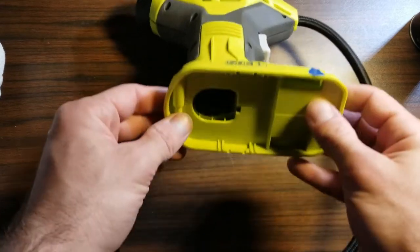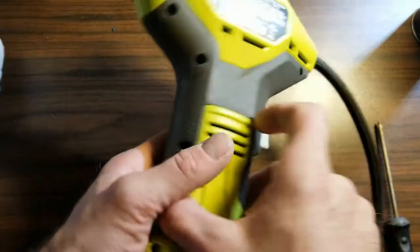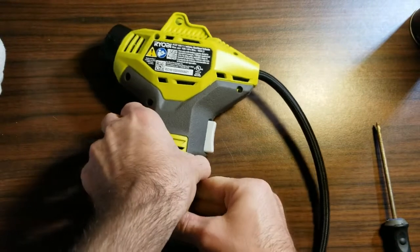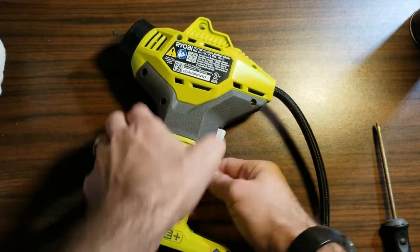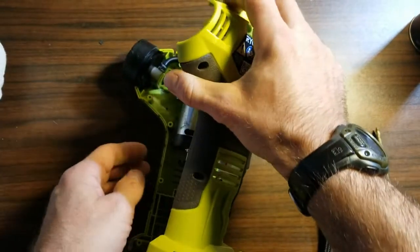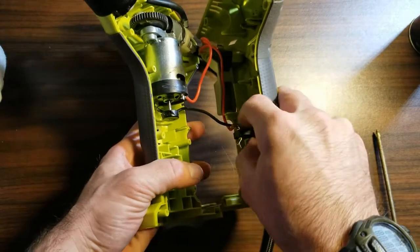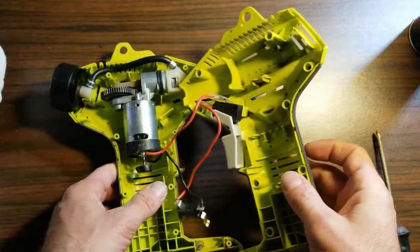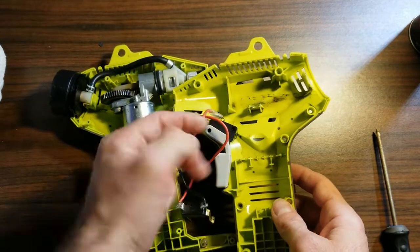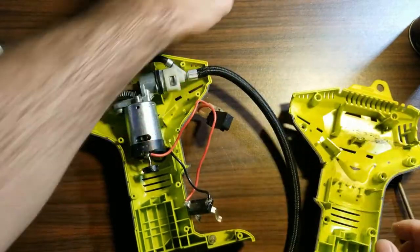Once that is done, from the bottom — I like to lay it first on its side — remove the battery and then lay it on this side. Now you're going to slowly pry this open and just be gentle because this thing is already cheap and prone to breaking. Once we split it, the connector for the battery terminals will stay on one side or the other, so just pull that out. Then the trigger with the switch is held on by two studs built into the frame — just pull that straight off.